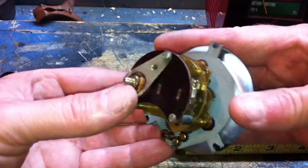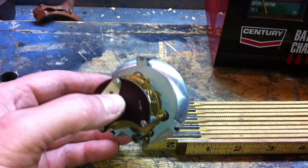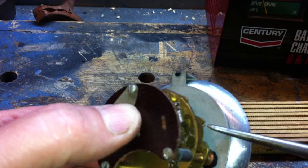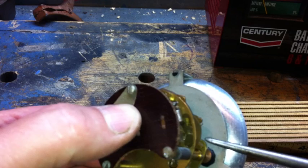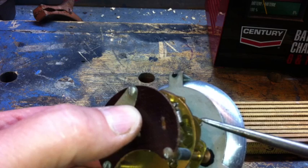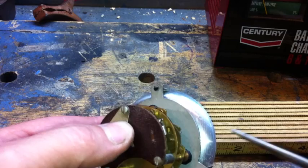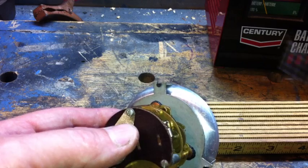I'm going to show you right here on the back, by the escape mechanism, your little adjustment lever. Mine is right here — it's almost all the way to the top. I found that after running this for several days and adjusting this lever, you can pull it all the way down to the base plate or all the way up to this plate up here, and all points in between, and it will adjust the speed of your clock.